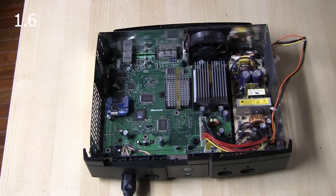Here we have a 1.6 Xbox. The way we can tell that very easily is by looking just to the right of one of the RAM sticks, and what we'll see is that there are no solder pads anymore for additional memory.